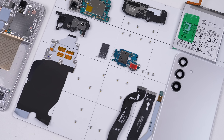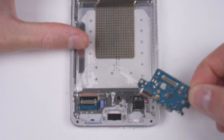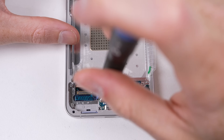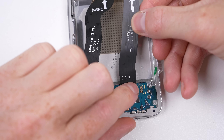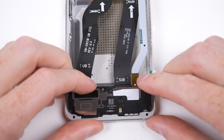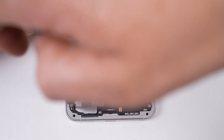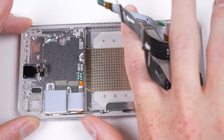It's held together with 23 Phillips screws, all of the same size — not only is it a manageable phone to disassemble, but it's almost foolproof. The new battery tab can help you get the battery out if the adhesive has already been softened with heat or alcohol. As for the display, while its cable is detachable from both sides, you'd have a difficult time replacing it from the front as the cable has no slack. The intended and easiest way to replace the display is as one assembly with a new frame already attached, which is why I have not removed the OLED from the mid-frame during this teardown.